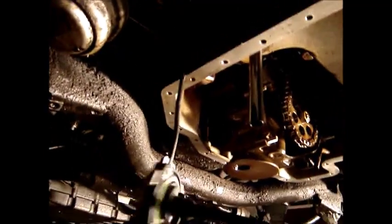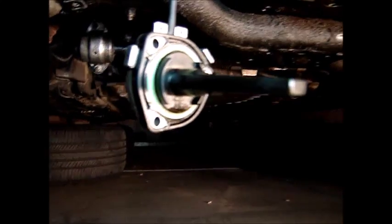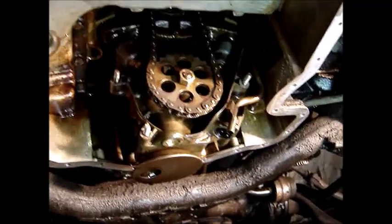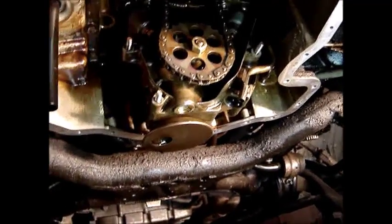On this sensor here, you always want to replace the O-ring. You can see the green ring in there — it bolts up into the bottom of the pan. The main purpose of this exercise while the vehicle is in this state is to take advantage of having the pan off. These vehicles are notorious for the bolts and nuts loosening up that secure the oil pump.